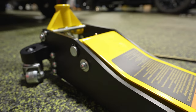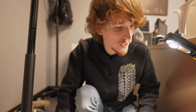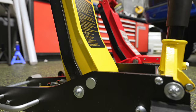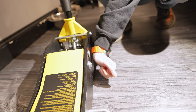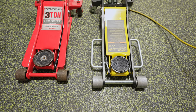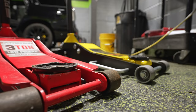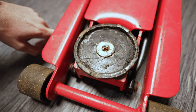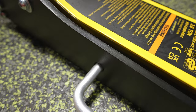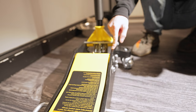The first thing we notice is the frame. This material is thicker than the Pittsburgh floor jack we have now. I have a magnetic watch — you can see it's non-ferrous, it's not sticking. So this is probably some kind of cast aluminum, whereas the Pittsburgh floor jack is steel with iron in it. You can see the sides are flared over as well as the bottom, which is probably to reduce lateral movement in the frame. But because this is thicker, I'd imagine they're around similar strength. The aluminum does help a little bit with weight, so if you're moving these around a lot, this one would be much easier.